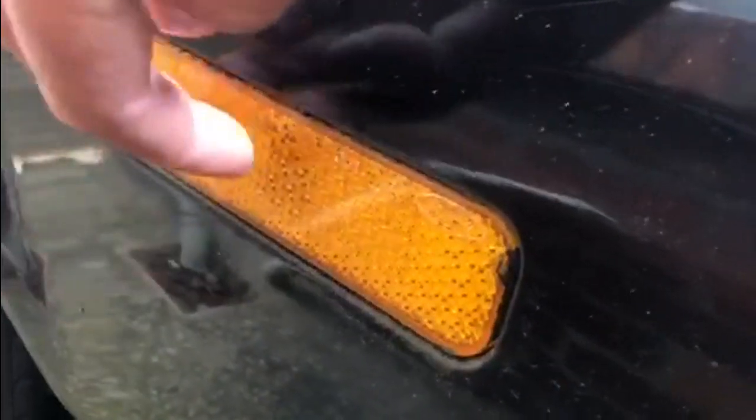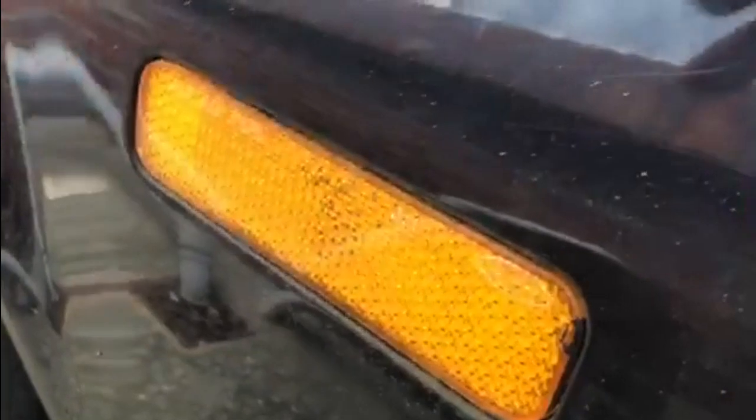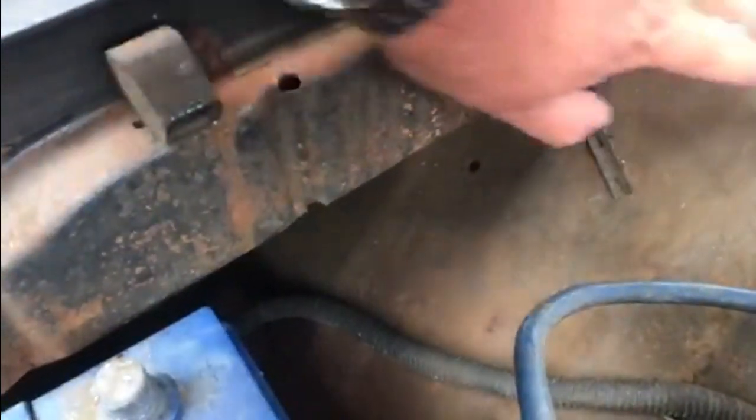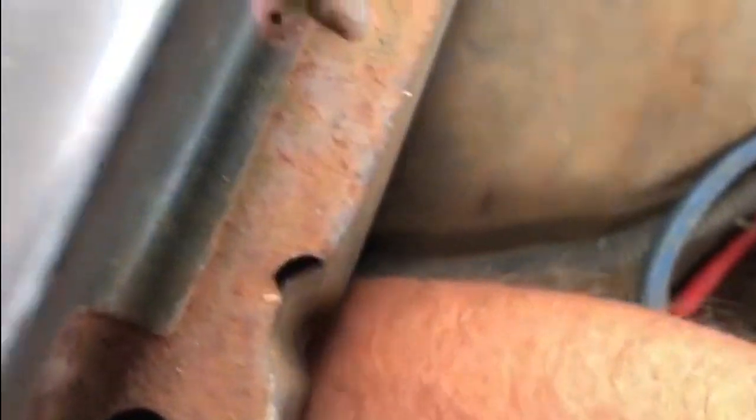The easiest way to get to that is from the inside — I'll show you where it is. There's no access to these side markers from outside the car. They actually fit from the outside into a little dished area, but they bolt in from the inside of the wing. On this one there's no full inner wing — there's an inner wing support and a mud guard or wheel housing, but your actual side light unit is way back here. Past the battery, it's back there — all it is is a little plastic clamp, and once you find it, it just twists out.